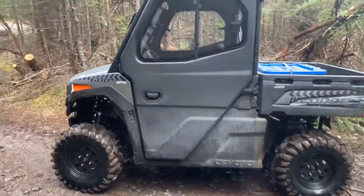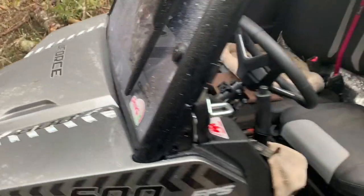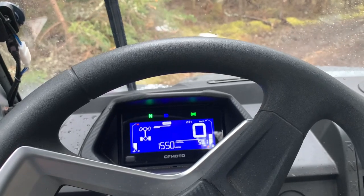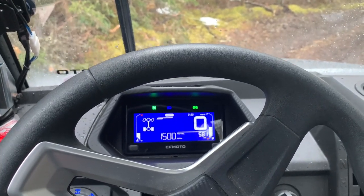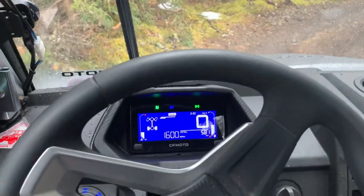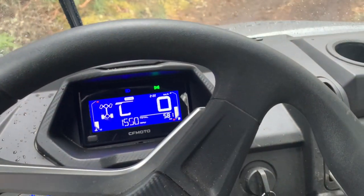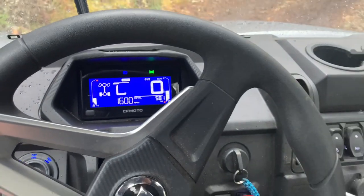Out testing now - it's a little wet, muddy, and rainy. I've put it all back together with the RNG stuff minus three of his weights. I've got the Stingray mods big tire helix, RNG primary spring, three 20 gram and three 12 gram primaries averaging 16 grams, and a stock secondary spring clocked to B1. Just from getting out here I can already tell the stock secondary in B1 doesn't give as good a back-shift as the RNG secondary in C1.